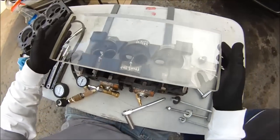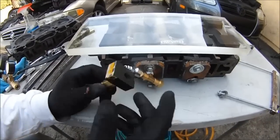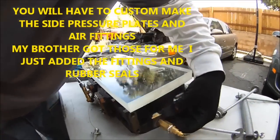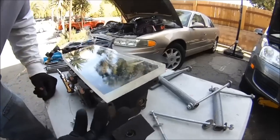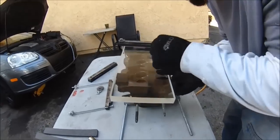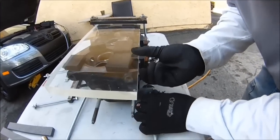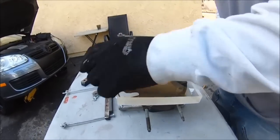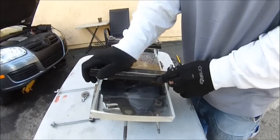This is good to go. Now what you do is put your plate on, just like that. A lot of heads are going to have different applications as to how you're going to inject air inside there. This plate was used for a totally different head — for the side of another vehicle — and I had to bolt the plate to the side. That was the only way I could inject air in there, but sometimes you got to improvise. All this is homemade. Grab the plate, position it right around these holes. Even this out, make the same reveal on both sides, go in just a hair — good enough.